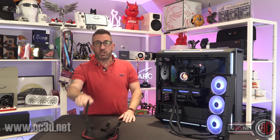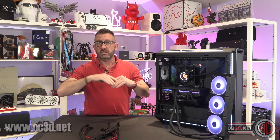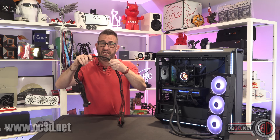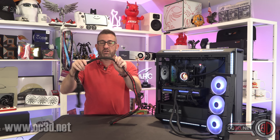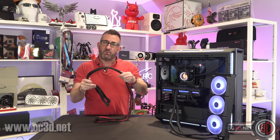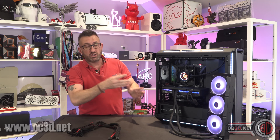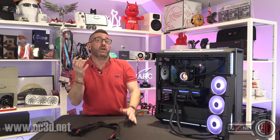I then got a brand new CableMod cable out and tested it. Everything went in fine. One thing I did notice was that I could sometimes improve the cable connection by changing the radius of the bend — realigning it slightly and routing the cabling differently — and one of the warning indicators would go away. There was a consistent change between different bend configurations. With the new cable, though, it was all green regardless. I could do really tight bends and it was fine.